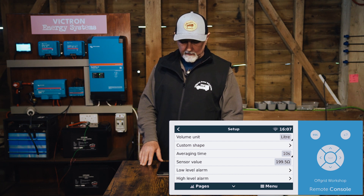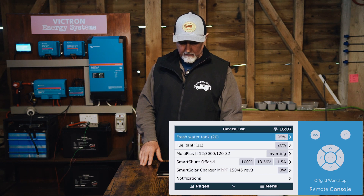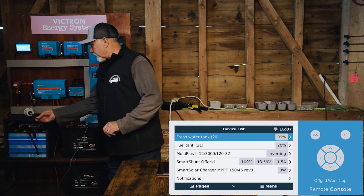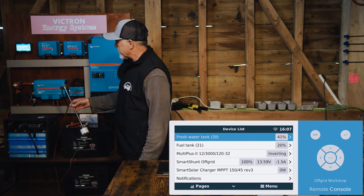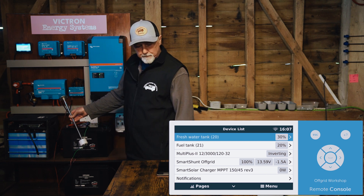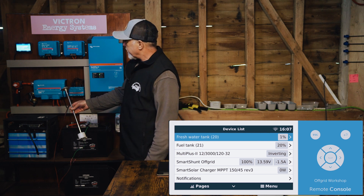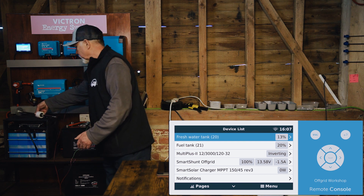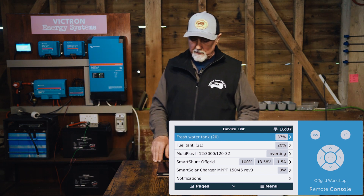Here you see the sensor value - currently it thinks it's 167.9, which is fine. So if I bring it up all the way to the very top, you'll see it's on 199.6. That's why I've got 200 - if it just happens to nudge up a little bit for whatever reason, I want it to not say it's disconnected. You need to set your upper value slightly higher than the maximum that your resistance can come from that sending unit. If I manually bring it down, that should be just about zero - you'll see it climb down slowly, until finally it is 1%. That's fine - around about the 50% mark.